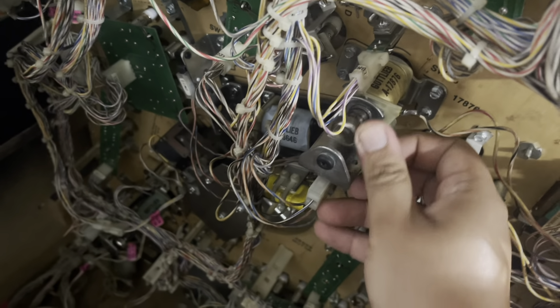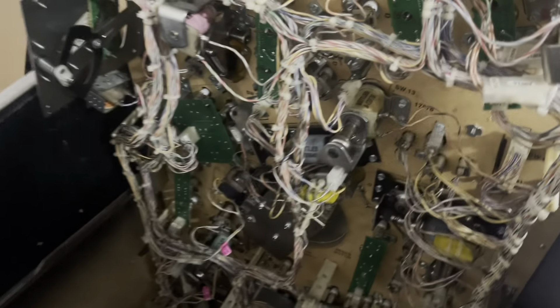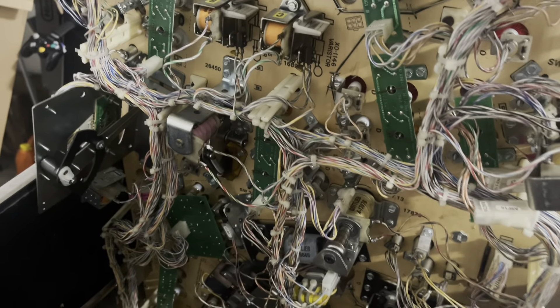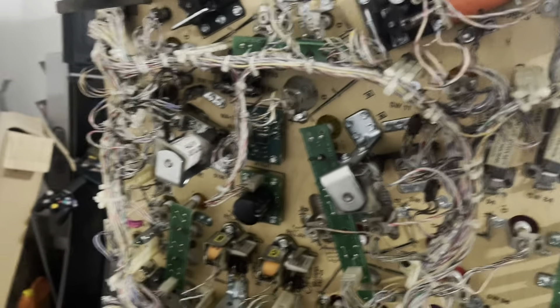I had to replace the springs because they were all gone — there were no springs left. I cleaned up as well. There's no subway system on this machine, so it's pretty easy to work on — everything's on top of the playfield. Working on the Street Fighter 2 and Mario Brothers, those are subway fields and a little more complex. But everything worked out great. System 3s are pretty easy to work on once you understand them; the only issues are with the boards themselves — soldering and desoldering, since the traces are very thin and things tend to come off.